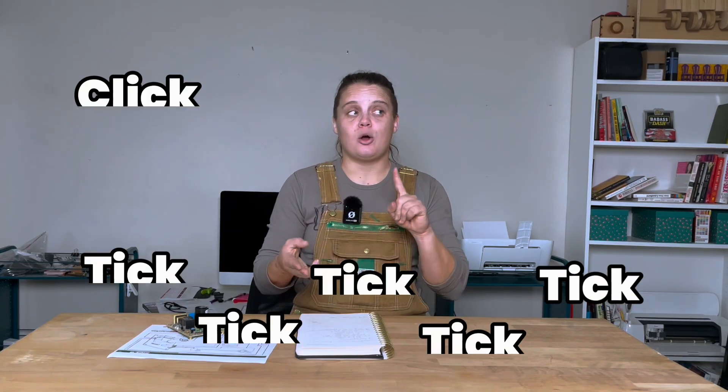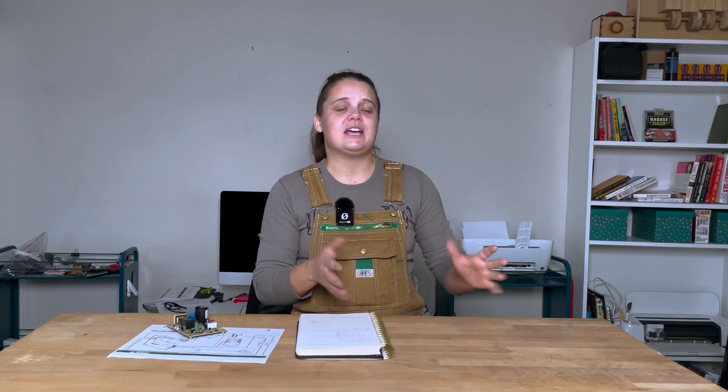Just as a quick review: your furnace when it turns on is going to blow for 15 to 30 seconds to blow any extra propane or unknown gases out of its burn chamber before it turns on. Then you're going to hear a click, tick-tick-tick-tick, whoom of the furnace actually lighting. Then it's going to run continuously until your RV is nice and toasty warm. When it's time for it to turn off, the fire is going to go out and then it's going to keep running for another 45 to 90 seconds in order to again purge that burn chamber.